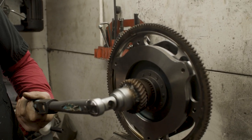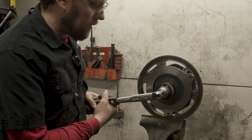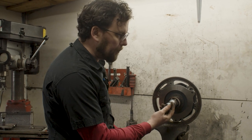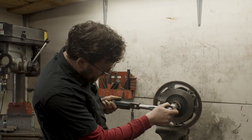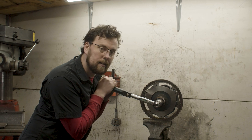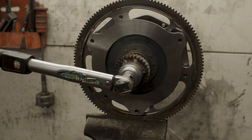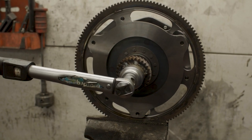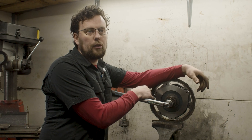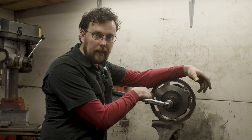Right now I have it set at about 80 foot-pounds. So we'll just see if it can hold 80 foot-pounds — it's holding 80 foot-pounds. We'll bring it up now to a slightly higher torque. Let's try 90 and see what it holds at 90. Okay, so there it is starting to slip. You can see that it is now starting to slip. That tells us the flywheel is slipping at 90 foot-pounds — it can't hold 90 foot-pounds. An orange diaphragm set up correctly should hold about 110 to 120 foot-pounds.